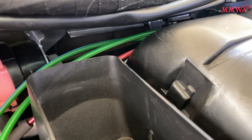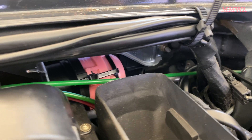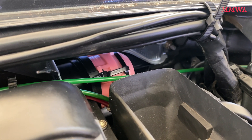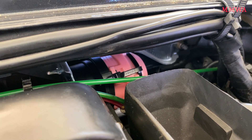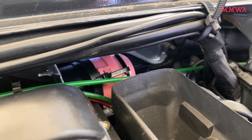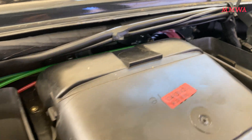So there we have it — these pods have been resurrected. I'm not 100% happy with that one, and of course it's the one that's the most difficult to replace that had the broken clip. But it's held together with the zip ties and I'm pretty confident with that. It's not leaking at all — I've tested it with the hand vacuum pump — and it's working perfectly on the car as well. In any case, it's a hell of a lot better than it was before.